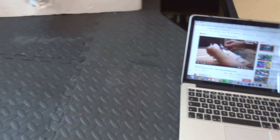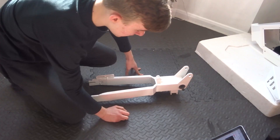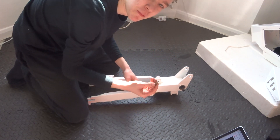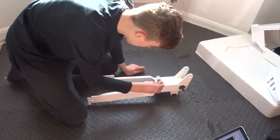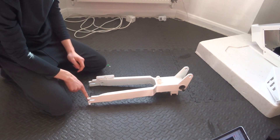I've just been watching a tutorial by a YouTuber called Bacon Butties — I'll put the link below, it's really helpful in telling me how to put this thing together. Another quick shout out is to Andy Kirby. Anyone in the DIY e-bike world will have heard of him — he's got amazing e-bike projects going on and he's the one who inspired me to buy this frame. So Andy if you're watching, you've played a bit of a part in this project. Now one thing he mentioned was that when the frame is painted these holes can sometimes get filled up. I've just got the bolts for the rear shock and it looks like I got lucky — mine are fine. But if you're building one, just check that your bolt does fit through. The seller also warned me that the bolts for the wheel can get gummed up.